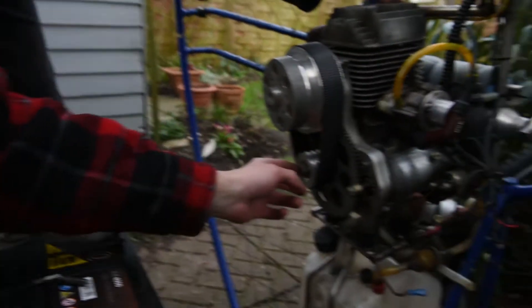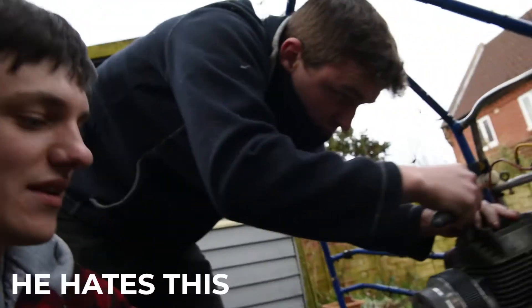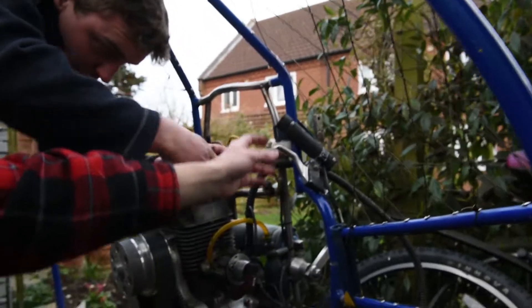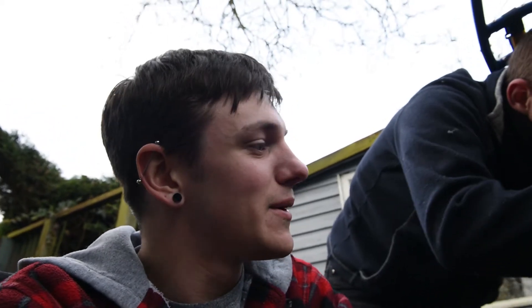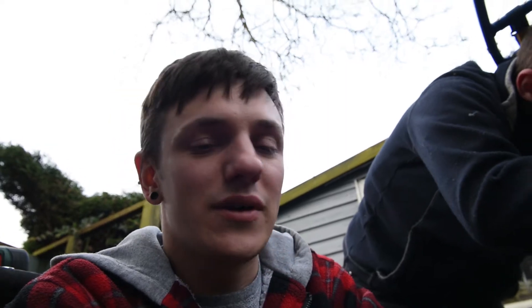Yo! So after all that, yes it was this bolt. It's not slipping — we lock-tied it up. Mark, being an electric mark and all, was like, what if it's this connection up here? Just shorting out. This button up here is your kill switch, it's linked up to this guy here, which will short out the frame — therefore not making a motor start.